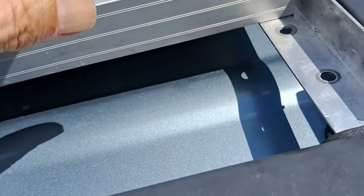My plan is to put two 100-watt panels up there. Since my system runs on 12 volts, the two panels will be mounted in parallel, so I get 12 volts and 12 volts with 200 watts coming in at maximum. Realistically you only get about 80% of it, so around 160 watts — but that's what's going on with my minivan camper upgrade.